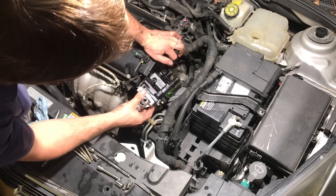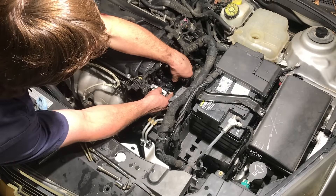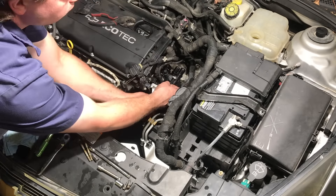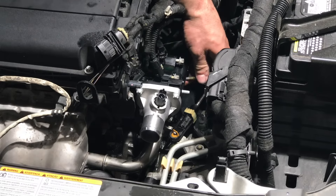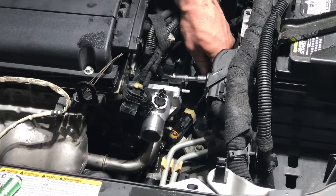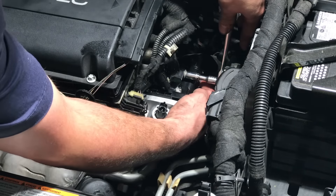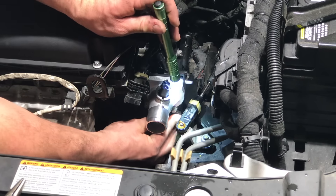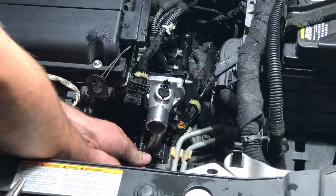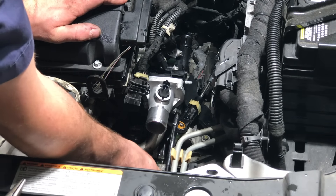After making sure it's a clean surface on the cylinder head, install the thermostat housing. Start with the two bolts on the top — always start these bolts by hand to make sure they're not cross-threading. Once started, put the other two in. Then position the coolant pipe going to the oil cooler in place, start those by hand as well, and snug everything up with a ratchet wrench. There's no need to get these extremely tight — remember, this is a plastic housing. The spec on these is about 71 inch-pounds, which is not much at all.